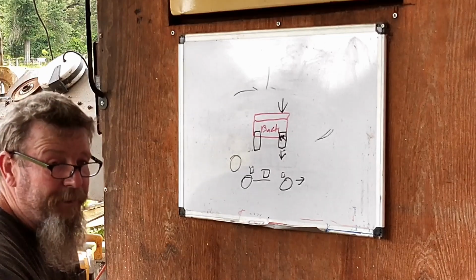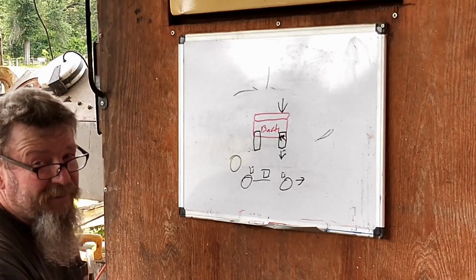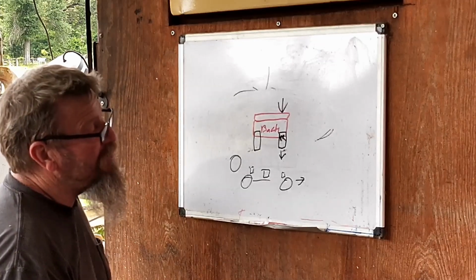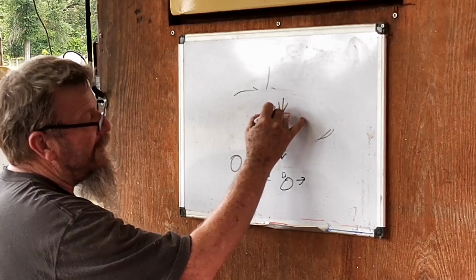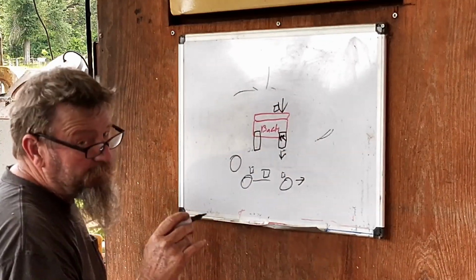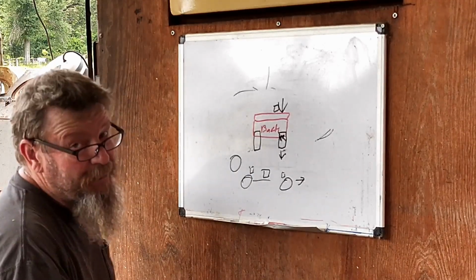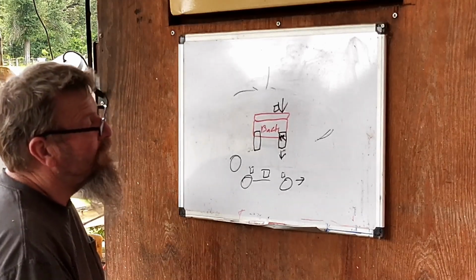And I don't know if it's just because of the algorithm or whatever, but I've been seeing more cars on dry tracks bicycle, and I attribute that to guys running right side lead and running it toward the center of the car where the right front and the right rear are grabbing. And you've got to be getting amazing side bite to just bicycle a car all by itself.